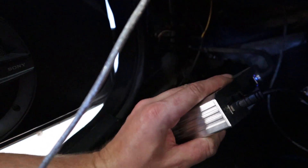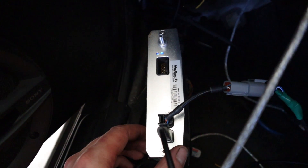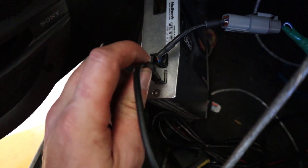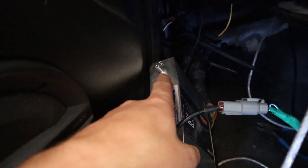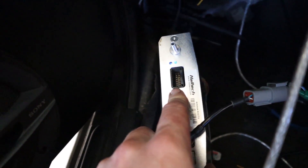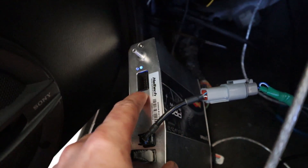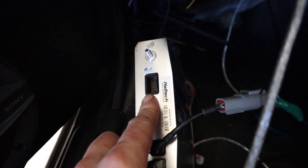I'll show you here on the front — or back side — of this ECU. On the opposite side to the actual engine loom plug, we've got the USB connector where we connect to tune. We've got the CAN input/output, which is what connects the actual dash to the ECU, as well as Brad's wideband setup. We've got the MAP sensor input, because we do speed density tunes with these. And this here is actually an expansion port on the ECU. Haltech obviously recognized that the stock ECUs were limited as far as their inputs and outputs, and they designed these ECUs with expansion provisions so you could put extra inputs and outputs into them — very, very handy.